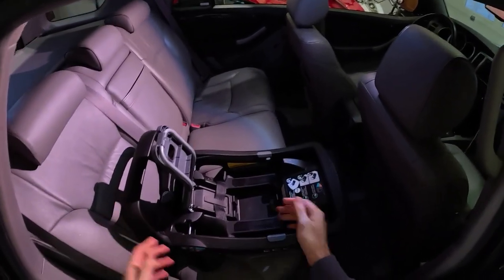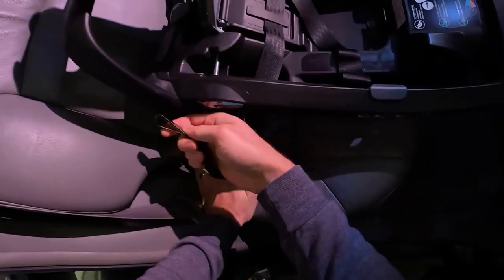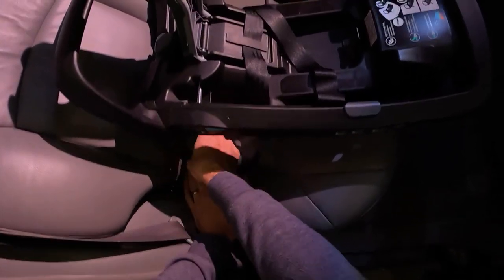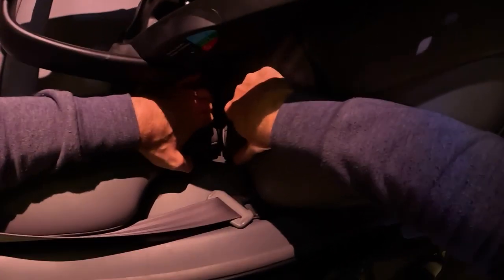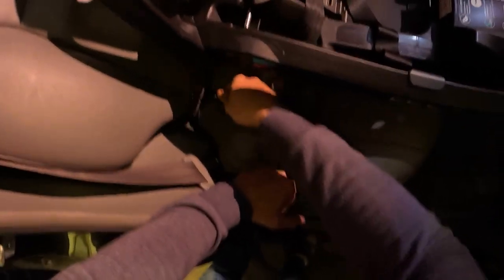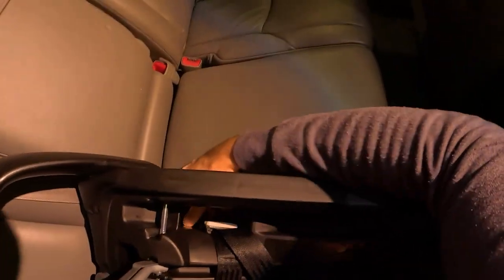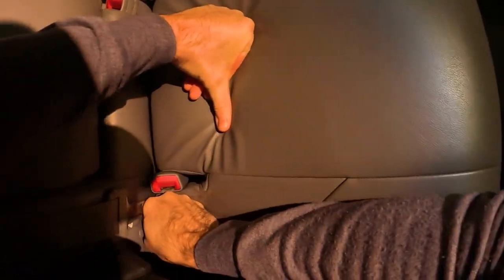Now I'm going to show you how to mount it using the latch tethers. Remember, you can find where these tethers are by the buttons on the seat. We just have a hook with a clasp on it. Snap that onto the metal hook — if you pull the cushion of the seat apart you can actually see it in there. Snap it on, give it a tug to make sure it's actually clipped on and not just stuck on the seat. Then do the same thing on the other side. This side can be a little more difficult to get at because sometimes the leather seat is pushed over on top of the hook, but get it on there.